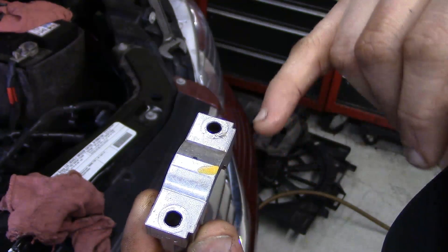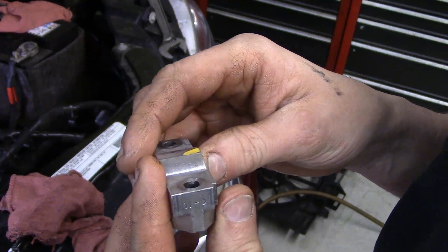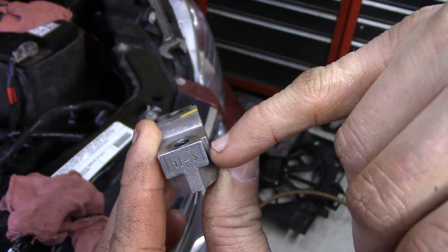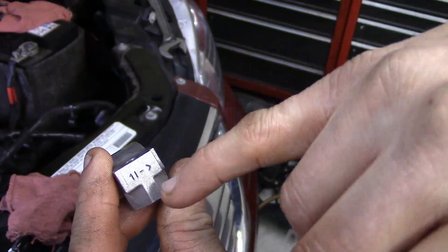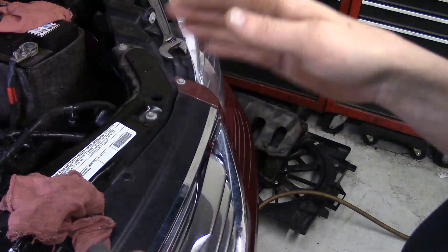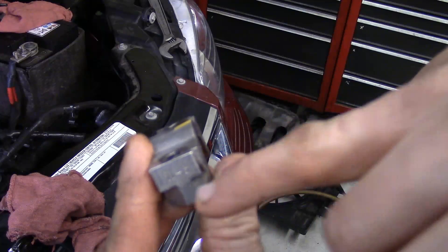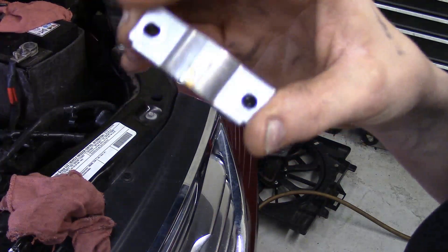It's got the corners clipped with the squares. Also on the side it's got a stamping. This one right here has a one and an 'I' and then an arrow. The arrow always points towards the front, which of course the corners are clipped as well. The one designates it's number one in order — one, two, three, four, five on the way back, however many there are on a cylinder head. The 'I' means this is the intake camshaft front bearing cap.